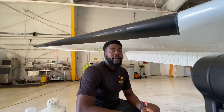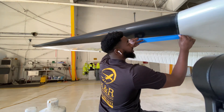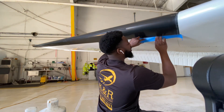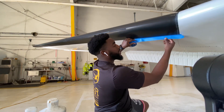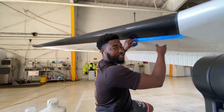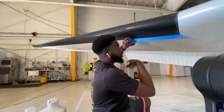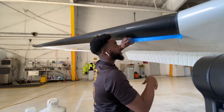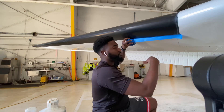This plane has already been washed and waxed, but if you are not going to wash the plane, what you would do is take this two inch tape, set it right about here, and run it all the way down and just let it hang like this. It's going to help the water not drip onto the paint — it'll drip around the tape right onto the floor — and it makes cleanup a lot easier. Just run it all the way down underneath the wing so when you're scrubbing the boots, all the water and old boot dressing just drips off onto the floor.